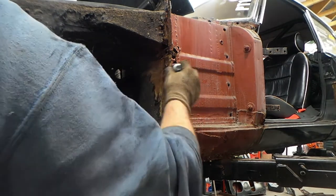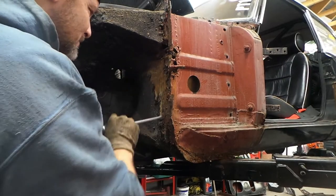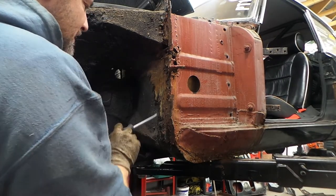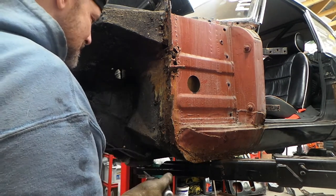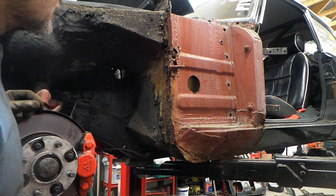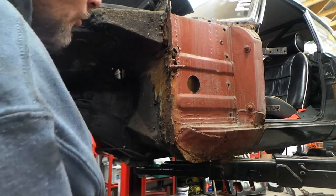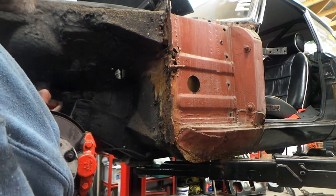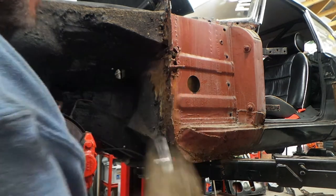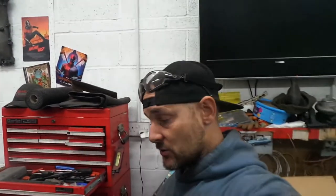Part of the footwell - the back of the footwell - has gone. You can either buy the repair section or the whole piece. It's actually gone across the straight bit, but it might be worth just buying the repair panel so at least it's done properly. Obviously the bottom of the A-post, as I said before, really needs some work, but that's no massive issue really - you could probably buy that piece anyway. So there'll be some internet ordering. What I need to do next is get the seat out. That's the end of this video, and I shall see you in the next part - thanks for watching.